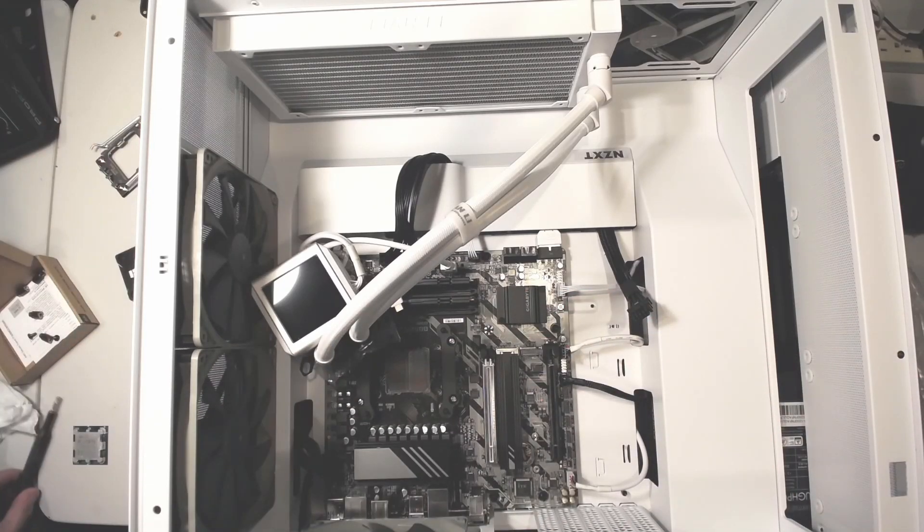It's kind of hard to see here, but I noticed there was a little bit of thermal paste still there, and I proceeded to clean more of the CPU — there was just a lot left from the last application. While doing this, I did actually install the CPU with thermal paste. I normally do a large dab in the middle, but I read online that for AM5 CPUs it's better to do the cross pattern, so I ended up reapplying it. I think I applied a little bit more than I should have.